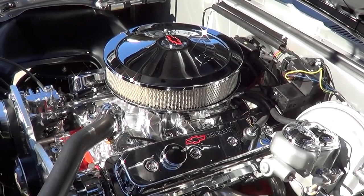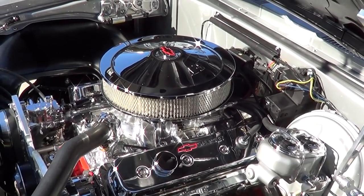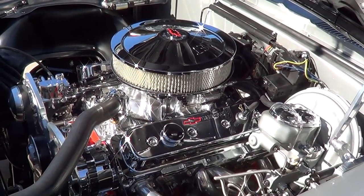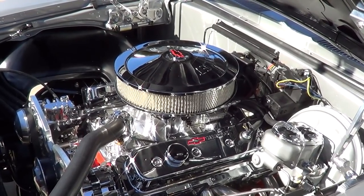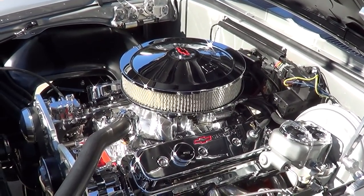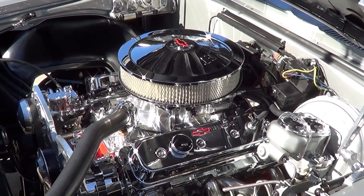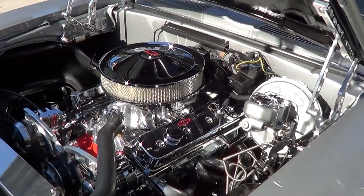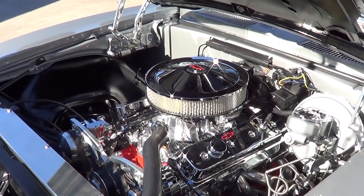And if you can get the engine broken in, actually we had the opportunity on this one. We cranked it with the headers and ran it and then got the timing and everything set well. And then we pulled the headers off of it, sent all the exhaust up and had them HPC coated. The biggest problem is you'll cook the HPC coating, the ceramic coating, on the headers if you have the timing off. When you first fire a motor, when you're running them in, they get hot and you get a lot of head heat. Yeah, and get your timing right and your fuel right, so it's pretty easy to mess them up. But we were fortunate on this one, we had the opportunity to start it before we HPC coated them. I just learned that recently, because you see pictures of motors on dynos glowing cherry red, but if they're tuned right, they won't do that.